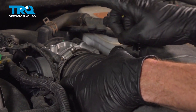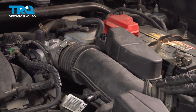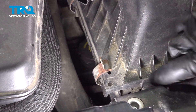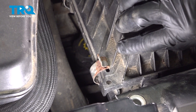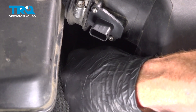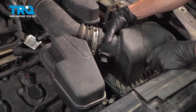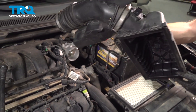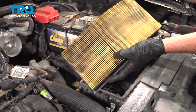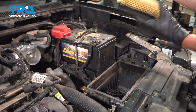With that loose, give this a little tug to separate it from the throttle body. Underneath that area, you're going to find two metal clips holding the top area of the air filter housing to the bottom. Pop both of those out of place, then grab onto the housing and remove it from the vehicle. Now grab onto that air filter, pull it up and out of there. Give it a close inspection — if it looks like it has to be replaced, now's a perfect time to do that. Set this aside.